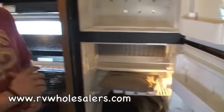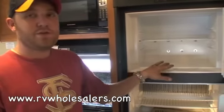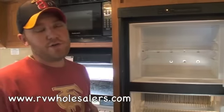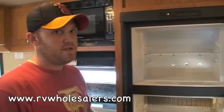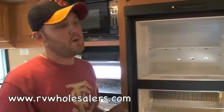The higher up that slat goes with the hose attached, the colder it gets in your refrigerator. Also, a good rule of thumb is every time you open up your freezer, open up your refrigerator as well. The reason for this is that the temperature is regulated in your refrigerator — if you open up your freezer and never open up your refrigerator, all the warm air trapped inside sits there and never cools back down until the refrigerator is opened.